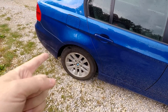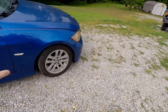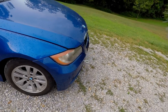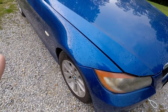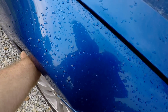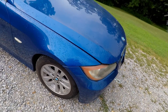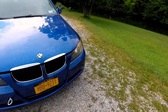Look at the tires. Are the tires all different brands or all the same brand? In this case they're all the same brand, which means they replaced everything at once. It's not necessarily bad if it has two different kinds of tires, but that means somebody was on a budget. Next, look at the front wheel — you're going to be able to check the control arms and ball joints from outside the car without even jacking it up. Roll the wheel back toward the inner fender. If you see any play, it's probably due for control arms. If you do it yourself, they're about $100 to $150 for the whole set.